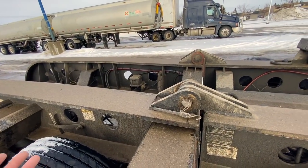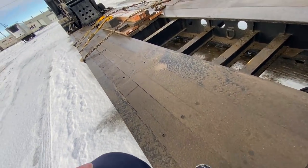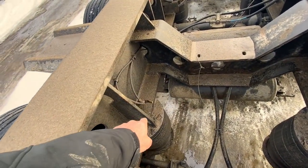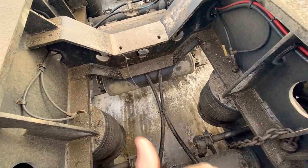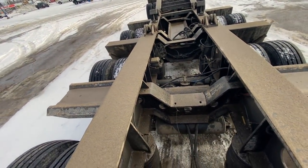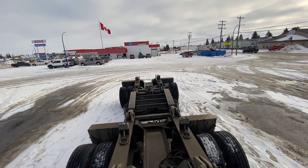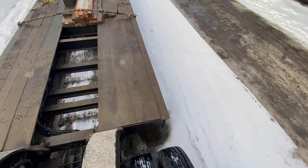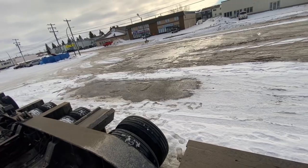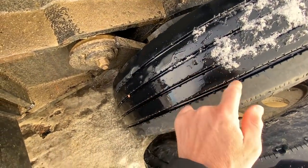With this kind of weather and stuff flying around, it's no wonder things get bad — especially air and electricity. All my airbags have these connectors so when I want to lift an axle, I put boards on the tires, drain the air, shorten the connector, close them, and reinflate. But something is really wrong on that last axle. I hope I'll get some answers from Fontaine, and if the plumbing was changed I'll go to a trailer shop when I'm back home or find one on the way.